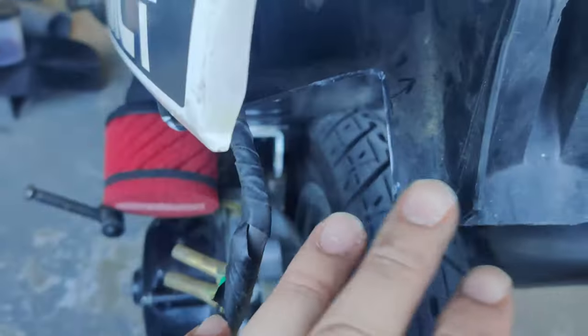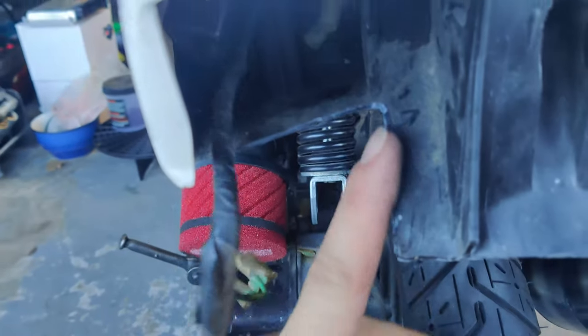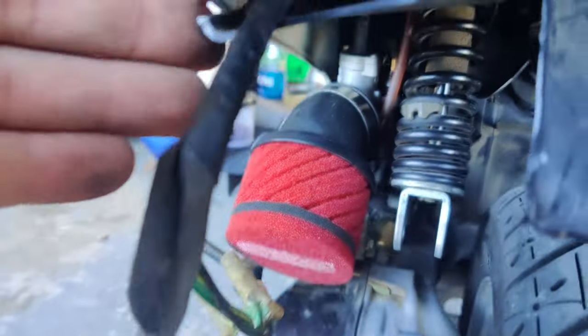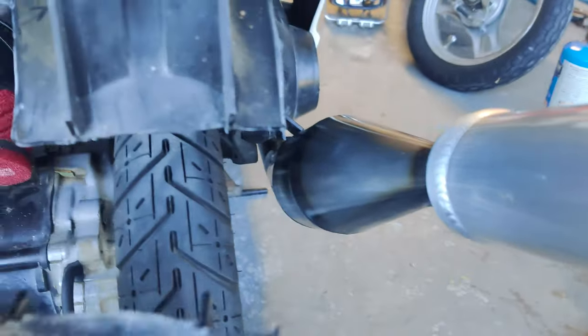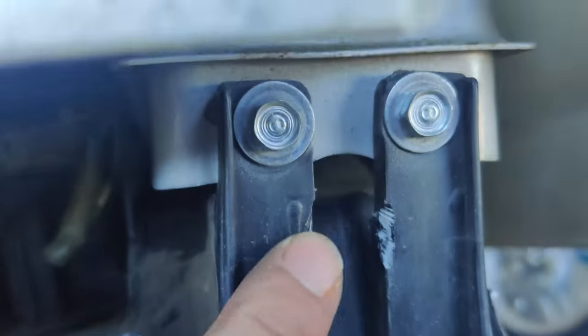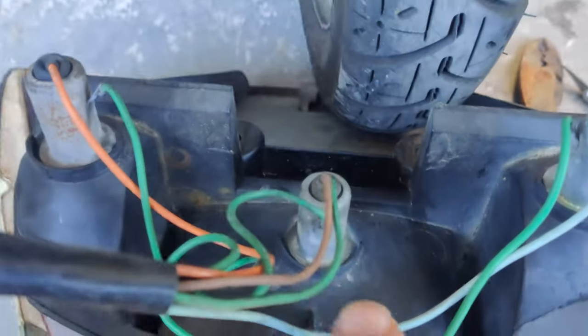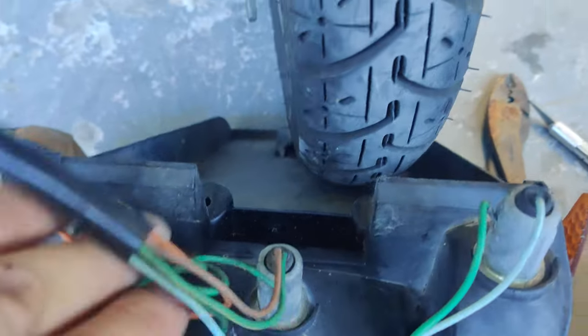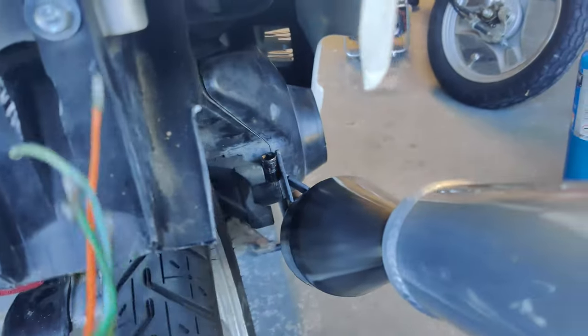All right, so I made my initial cuts here, and I think we're actually good. I notched this part out and got it to where it sits nice and flush inside of there. Cut off this bottom part where the bottom mounting bolts were at because they're in a different location on this tail light. And I also kind of shaved down, grinded out the inside of that so that this light bulb socket can slot inside. So let's see what we can do to get this thing put in here real quick.